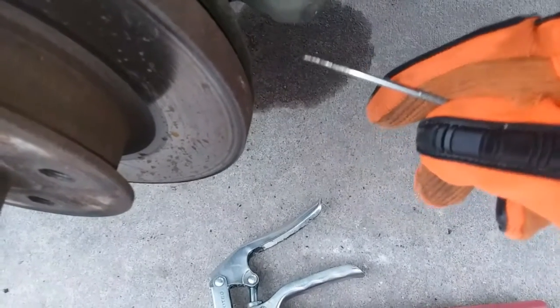From that line, you measure over to the other side on the other front tire, and then you go to the back and measure from that line to the other line on the back side. Once you get the same measurement on the front as you do on the back, you know your alignment is straight that way. I don't deal with the up-and-down angle, but just to get the tires running straight — measure between the two lines and turn your inner tie rod until the front and back measurements match. That gives you an alignment to an extent.